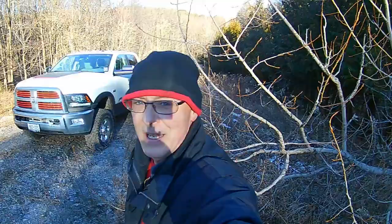Okay, so that's the video for today. Hope you enjoyed the video. I wouldn't recommend doing it the way I did by yourself, especially on a hill this steep. I mean, if that strap broke because of the rock, the Power Wagon would have been gone. No way I would have caught it. So always have two people. So I just did that to show you. I took a chance. And I had faith in the strap. Anyway, that's how you pre-tension your winch.